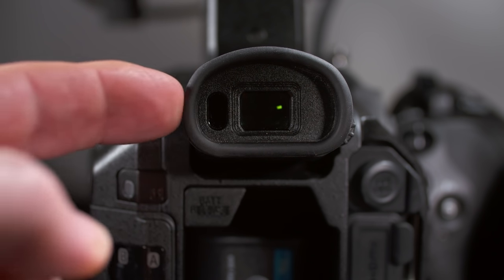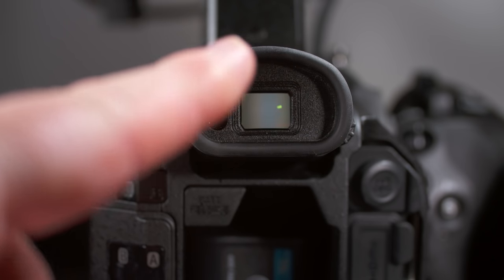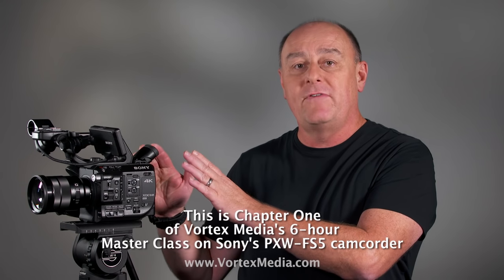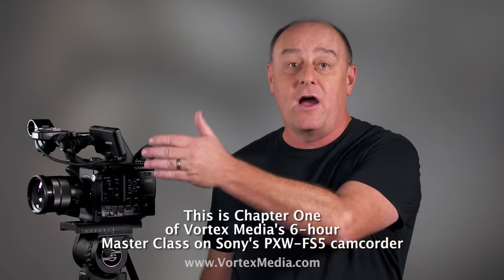There's a small proximity sensor that detects when your face is coming up to the viewfinder and automatically turns it on, while the LCD monitor turns off. However, one of the most irritating things about the camera is that this proximity sensor is too easily fooled by anything within about 6 inches of it — causing the LCD monitor to turn itself on and off at the worst possible moments as your hands, arm, chest, or anything else near the rear accidentally triggers it. I'm hoping Sony will address this with a firmware update.